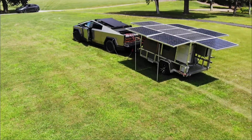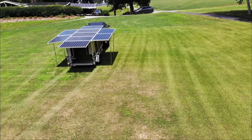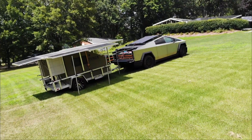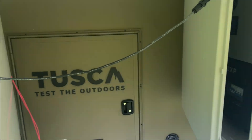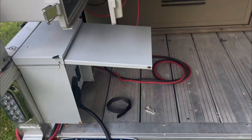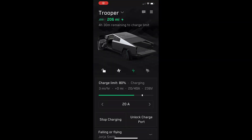I don't power up the inverters on the trailer except when I'm stopped and the doors are blocked open, but I'm at least getting 400 watts worth of charging while driving. Here's the back setup — it's a cheap little box you might find at a campground, tied to those two inverters. I have an Anderson connector that lets me connect into the big box, and the small box on the trailer is already connected to a bus bar in the back.